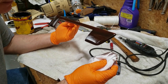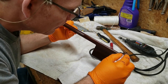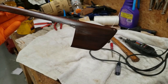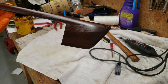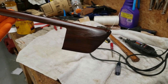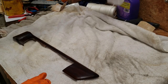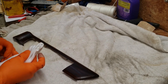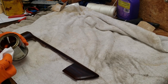That's pretty amazing. I'll get another little dab on that light part right there. I'm not sure whether I'll put another coat of stain — this may be it, so we'll just see how it goes. We will definitely be adding two or three layers of polyurethane and sanding between each one. We're ready to go for our first coat of high-gloss polyurethane, and again we're going to use a clean, mostly lint-free cloth.